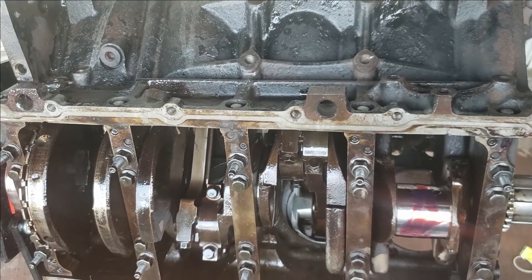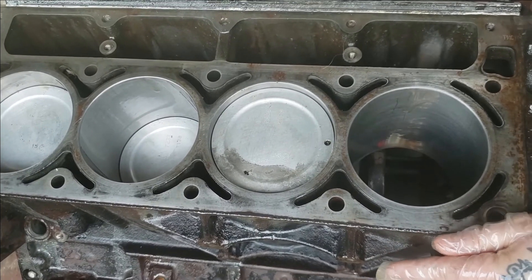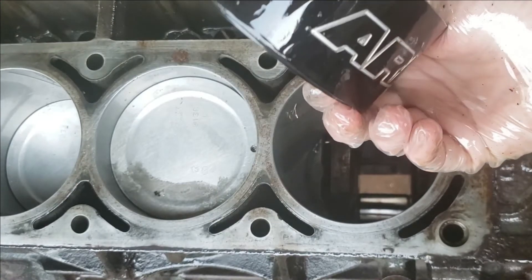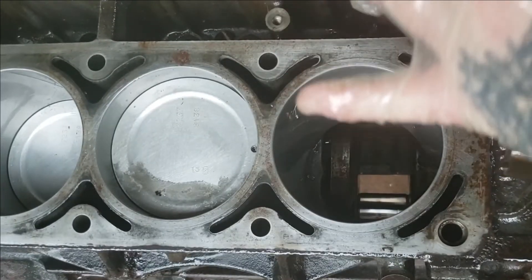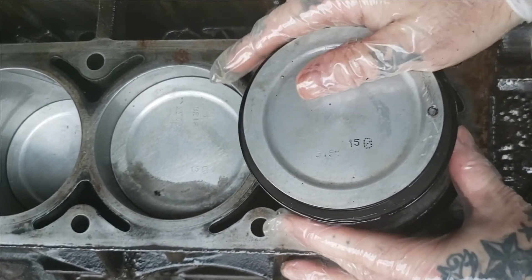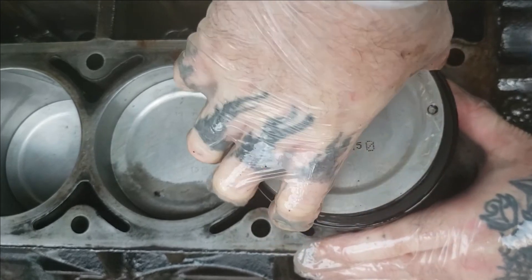Turn your motor over. Because we are working with piston number two, we need cylinder two. Now as you can see, your cylinder is nice and clean and ready for install. We are going to take the piston that we got our rings and everything lined up on — double check it, which it looks pretty good to me. I highly recommend you get one of these ARP four-inch bore tapered sleeves. You just put your piston down in it just like so, make sure it's facing the right way and your rings are where you need them. Line it up in the bore, make sure it's straight — if not you'd have to twist your piston and it'd be a mess. Make sure all your ring grooves and everything are lined up so it drops down in good.